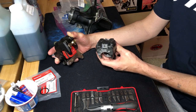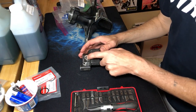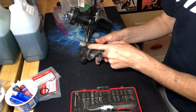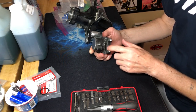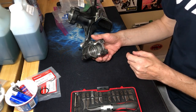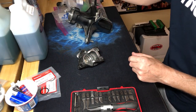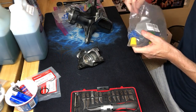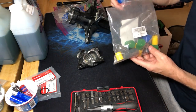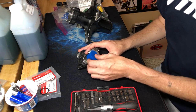We're gonna rebuild this - I've got it all polished up ready to go. We're gonna throw some paint on it and we need to prep it for paint. We need to do a couple of things - we don't want any paint in certain holes. We need to plug things up. First off I'm gonna hope I have a plug that big. I got a bag of plugs - looks like that blue one will fit right in there. These are high-temperature plugs too, so if you don't want to do powder coat you can put these right in the oven. We're gonna use caliper paint.